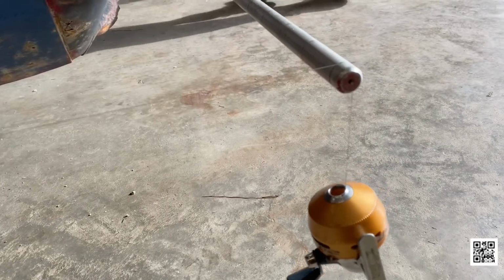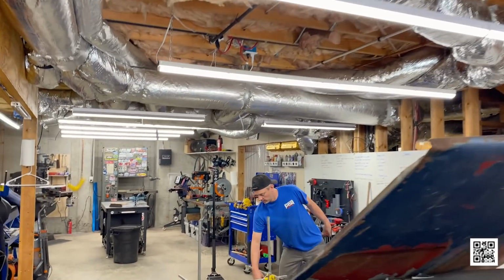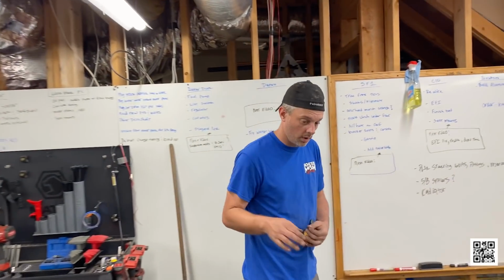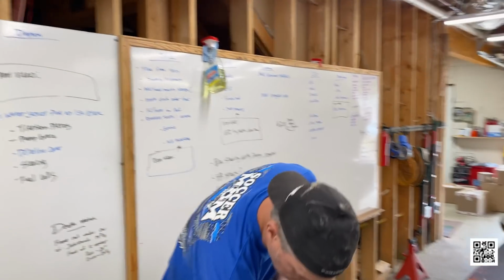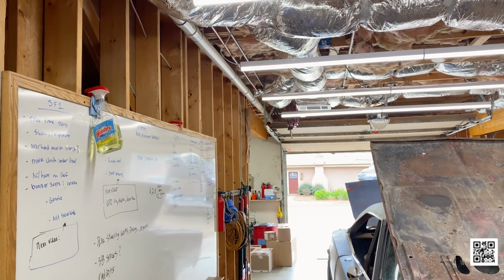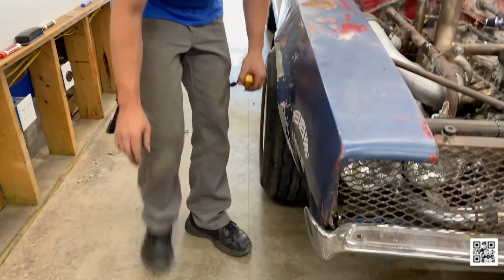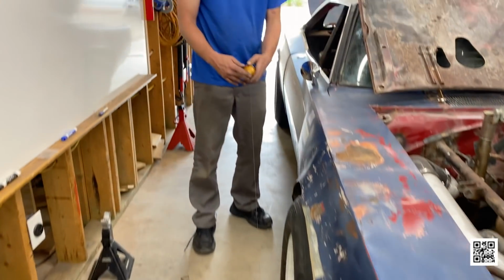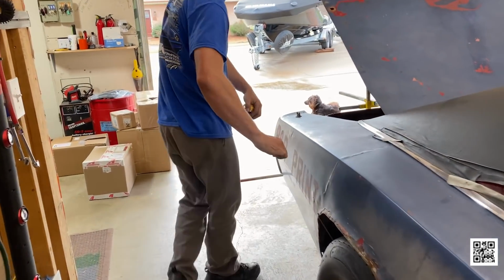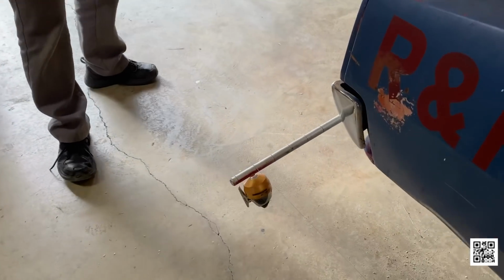Yep, and what we'll do is get it as close to the wheels as we can. They don't necessarily have to be on the same groove on each side, but front to rear, if this is 2 grooves in here, we need to be 2 grooves in on the back one, so that we maintain parallel. So I'm going to try the second one in here. Dude, this is cool. Guys, I'll find this online and put a link in the description because this is pretty sweet.